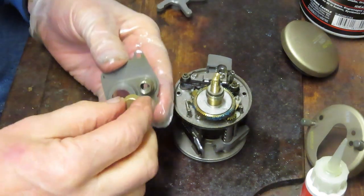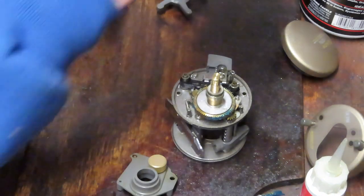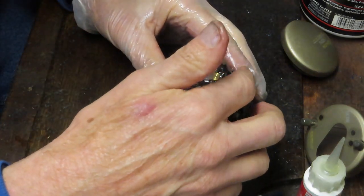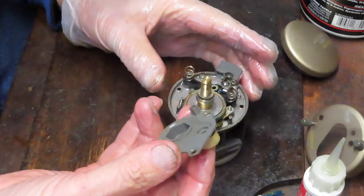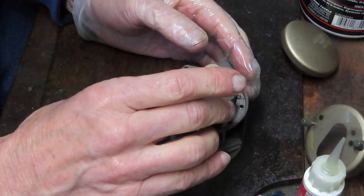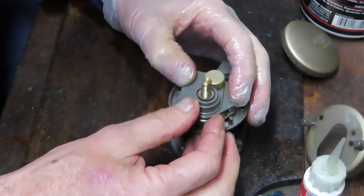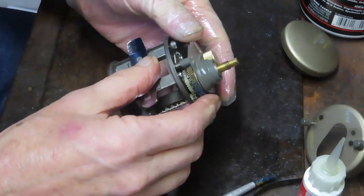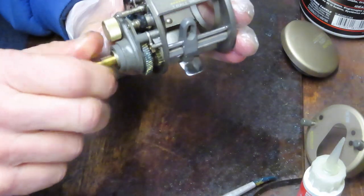We didn't need to take this cover off, so I'm going to put that cover right back on before I go to reinstall the balance. I'm looking at my parts tray — I've got my two springs here, those go next. Then we have a little bit of a balancing act: we have two pieces that are going to go on each stud, and then we have the two overrides for the yoke spring. Now I'm hearing all those snaps — those all sound like they're in good stead. You can actually give it a spin at this point and see how it's doing, and it's doing just fine.